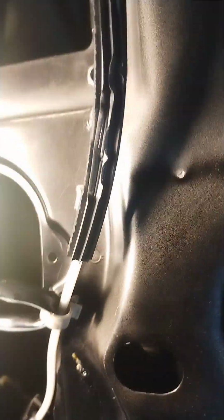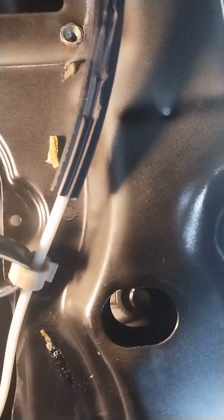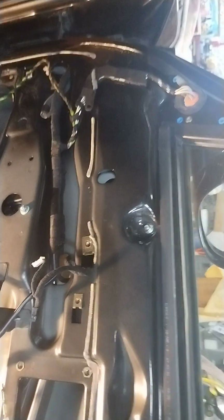Now, today I got this Porsche 911 Carrera Cabriolet, and I just put a window regulator in it. I'm going to show you the basics here. Right here is where you adjust it, and that's where the window mounts. Same on this side. Those things, I hate tightening those because they're squeezing on glass with rubber, and rubber and glass don't get along. It tends to break. There's one here, and there's one on the bottom over here, and one on the bottom over here.